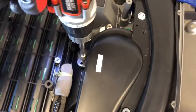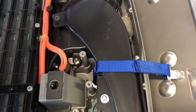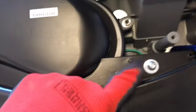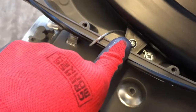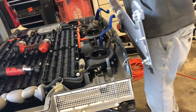You can start off by removing this Phillips head for your fan — put that in the box so we don't lose it. There's another Phillips head right here and a third one right here. Then you have four Torx 30-bit screws: one right here, one right here, a third one right here, and a fourth one right here. You'll be able to remove this cover and move it to the other side.